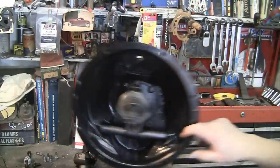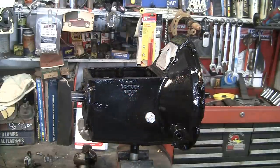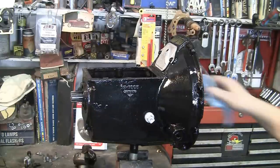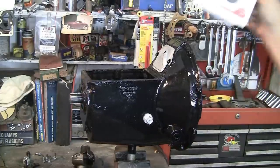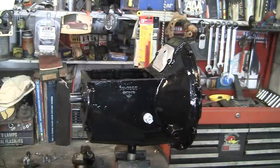This also has the 787006 transmission case, which is the highly sought-after transmission case. It's not a '39 case, which is just a little bit better, but the gear ratios are all the same. I got the idea for the mount out of Vern Tardell's Ford Transmission Service and Repair — very good book. All of his books are very good.